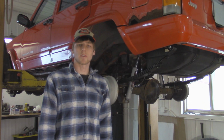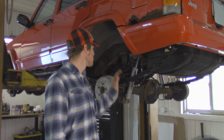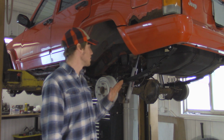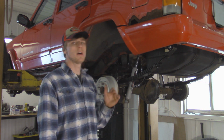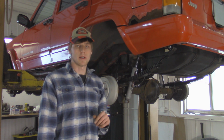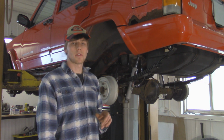All right guys, that's it for the rear suspension. We got everything all bolted in nicely. The only thing I didn't do is torque down the leaf spring bolts. That's because I want to do it when everything is back down on the ground, but I'm not going to do it in this video because we still have the front lift to get installed, and that's going to be in the next video.